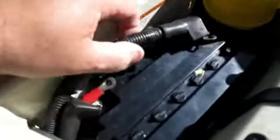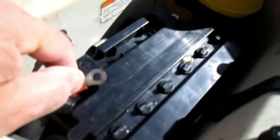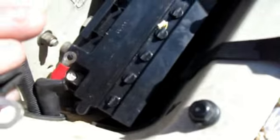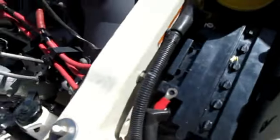We've got the battery in. I'm getting ready to hook up the connectors, but I noticed there's quite a bit of corrosion right here. That positive cable should be nice and clean, but it's got buildup on it — and so does the negative. So I'm going to be wire brushing those and getting them all clean. I also got the drain hose hooked up on the back of the battery, and that feeds through right here. We're going to finish cleaning this up and then we'll see if it turns over.